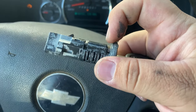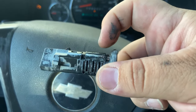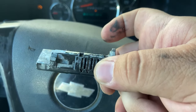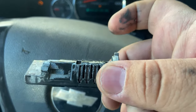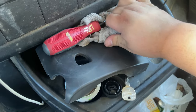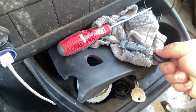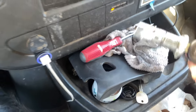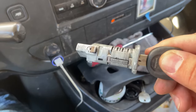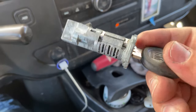If we look at it, that's our sidebar - that's what keeps the ignition from turning. Once it goes down when you put the key in, it should turn. But for some reason I believe the wafers are already wasted on this thing, so we're going to go ahead and replace the wafers with some new ones.